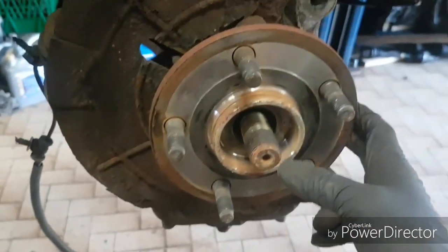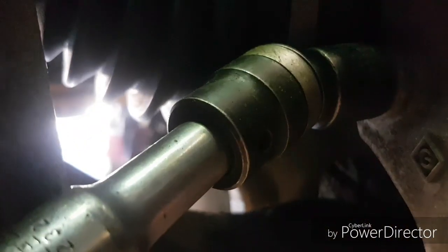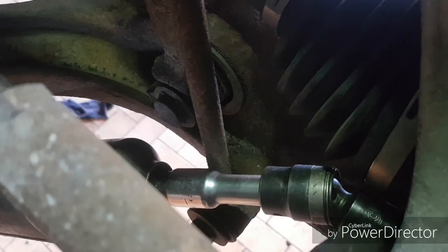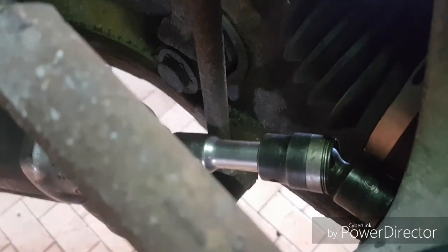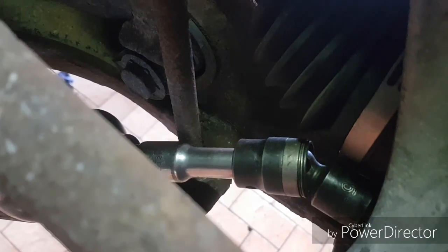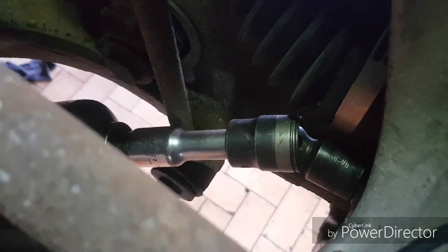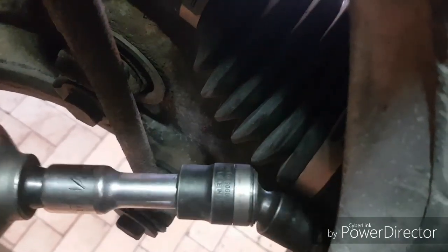Our hub is here. I'm going to unbolt the bolts in the back and then show you the slide hammer afterwards. I have the impact gun set up with a wobble socket and a short extension. It's nice to have these universal wobble sockets — this one's a 15mm. You can buy these anywhere. This particular set is from a local tool supplier, TechPearlTools.ca — shout out to TechPearlTools. The socket is angled so we can bypass the sway bar link with the short extension.